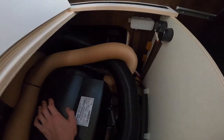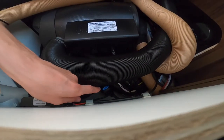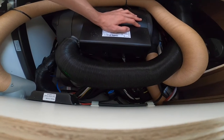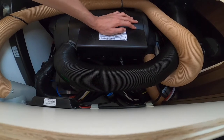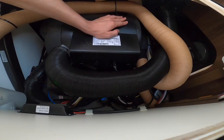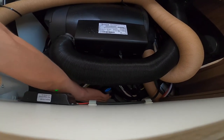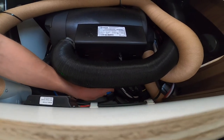So to drain it down, just behind this pipe here, you'll see the blue tab. On that device, it's called an anti-frost control device. So at 3 degrees, it'll automatically drop the water. But I would never rely on it, because if it becomes faulty and you've relied on it, it's going to cost you a lot of money. So always check it. So to drain off, when it's across the vehicle like so, and the button on the bottom is pushed in, it's holding water. Turn it.